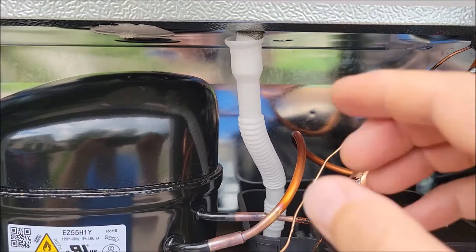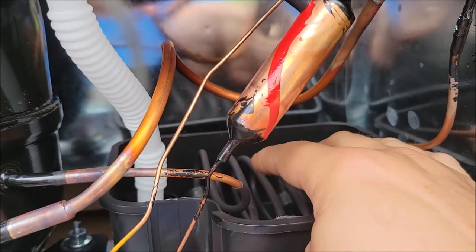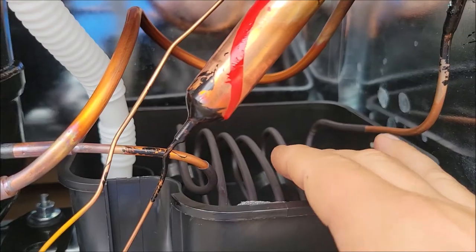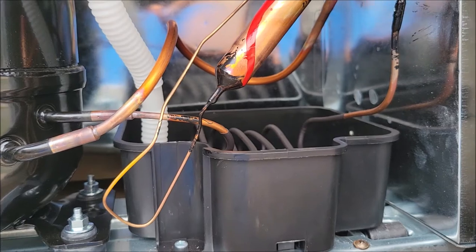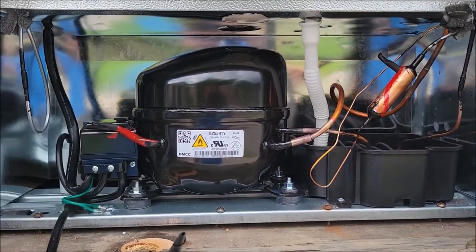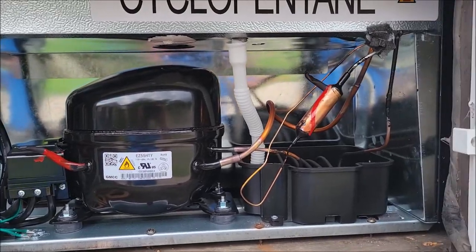Some things you'll notice: the evaporator drain — or condensation drain — is right here, which drops down into this tub. Inside this tub is a coiled line that gets pretty hot. So the condensed water comes down here, gets trapped in this little container, and then evaporates when the compressor is running and the lines get hot. Basically it's a kind of closed-loop system — you're going to get a little more humidity in the RV, but you get that all the time anyway. A dehumidifier is your friend in RVs. I think it's going to work out great, and a lot of the nicer RVs you buy now already have residential refrigerators in them, so this is basically the route things are going.